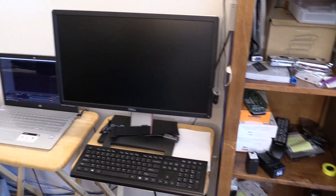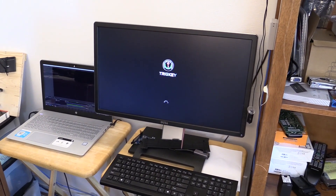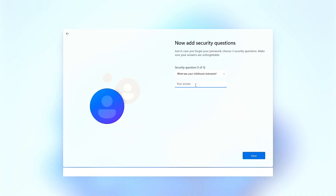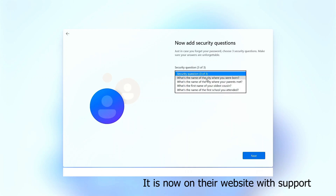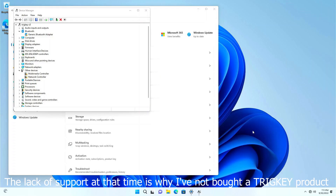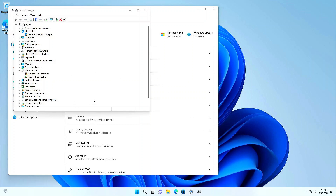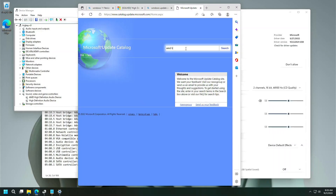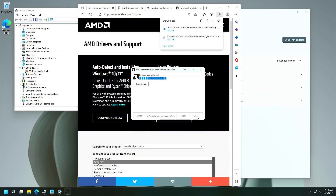Because of the questionable origin and security risk of this machine, I didn't initially hook it up to the network until I had a firewall and could put it behind one and sniff the packets. I decided to reinstall Windows 11, and that's where I first ran into issues getting a few things to work. I emailed TrigKey support, as at the time this machine wasn't listed on their website. I got a fairly prompt reply stating they were on holiday break and would not get back with me right away — and when they never did, I started searching around for driver support. Not working were Wi-Fi and Bluetooth as well as something with multimedia. While Windows Update failed to bring anything in on its own, I did go to the Windows driver catalog and find one item, while the rest were taken care of by downloading and installing something from AMD.